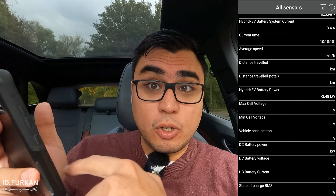Press 'All Sensors' and then scroll all the way down. The second from the bottom you will see a line named 'maximum energy content of the traction battery' — and it's exactly what it says. It will show you the usable battery capacity of the car.